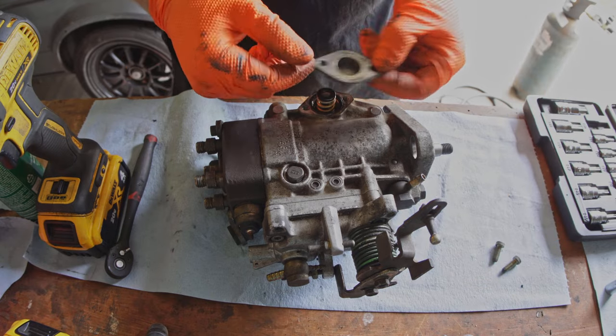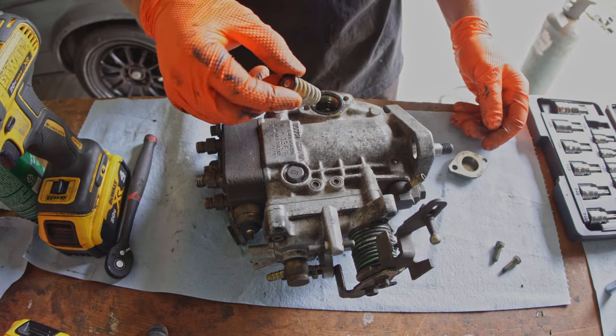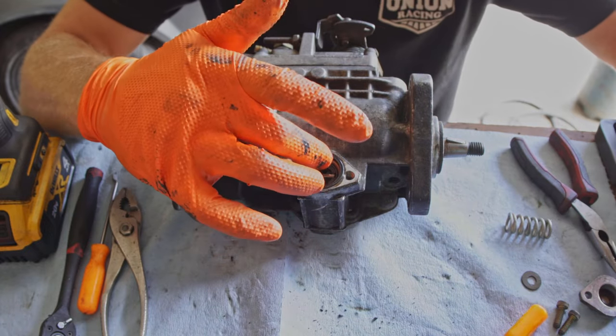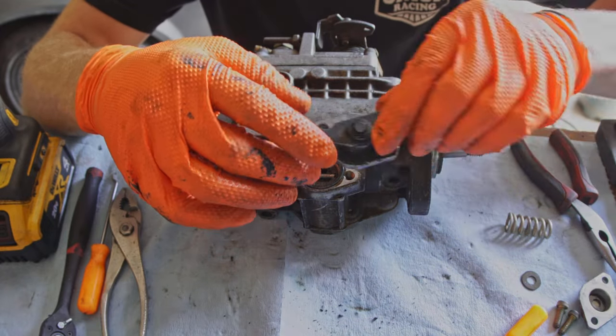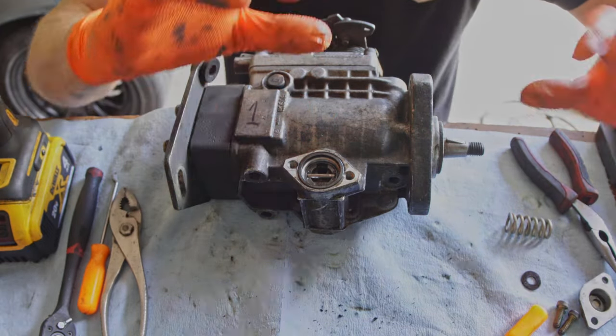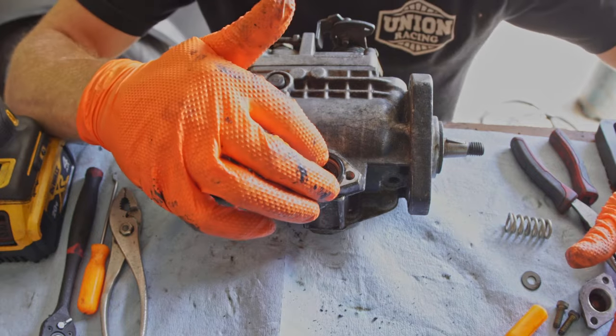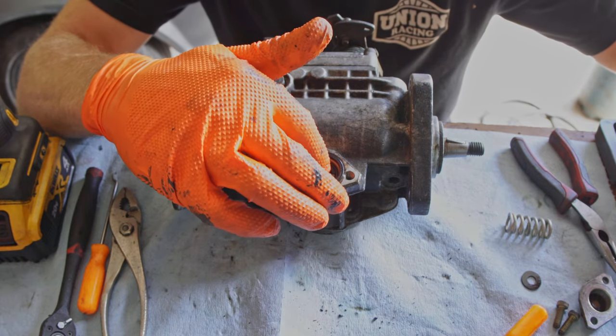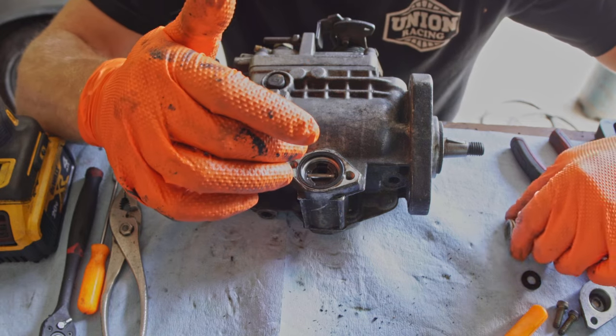So here's the inside of the timing cap, here's the timing spring. This is the choke side. Here's the piston. So the piston receives fuel and it pushes against this cavity. So that makes the piston go the other way. The piston rotates the internal pump timing. So essentially, this is a dynamic timing advance built into these Bosch pumps.